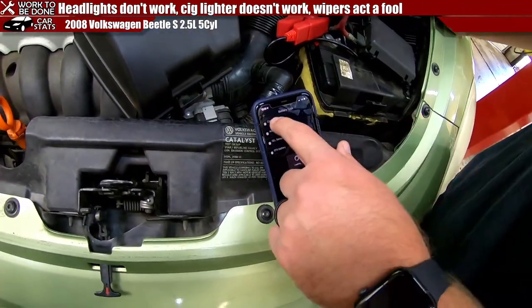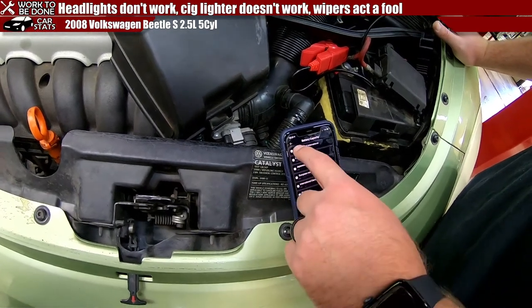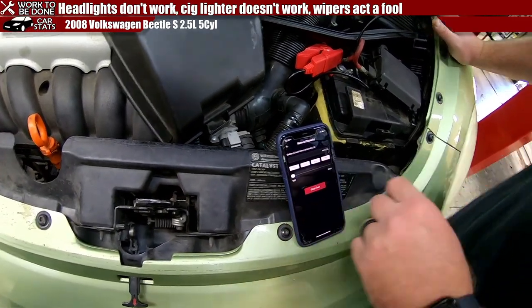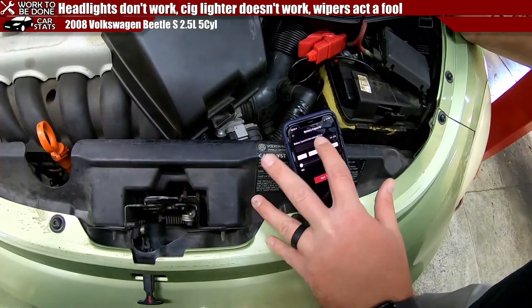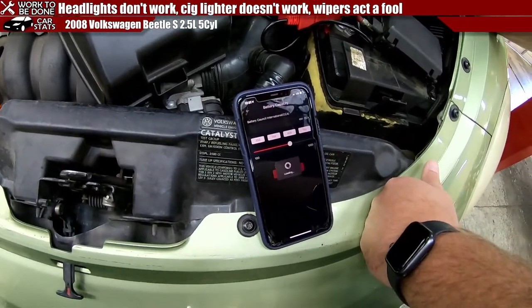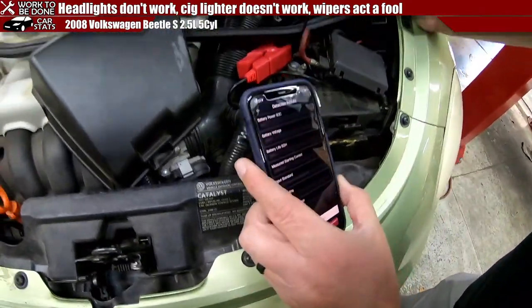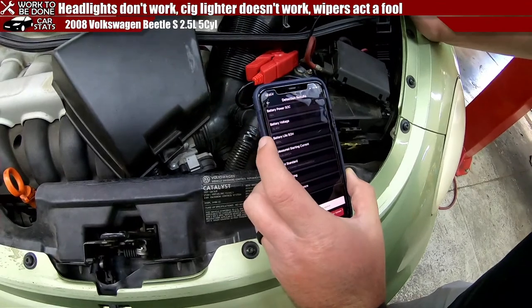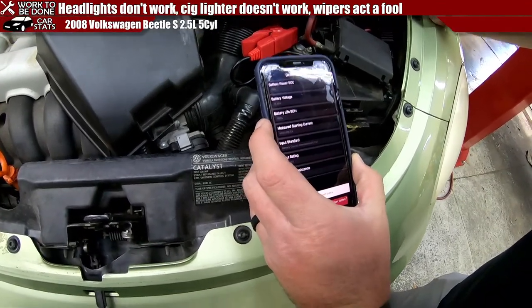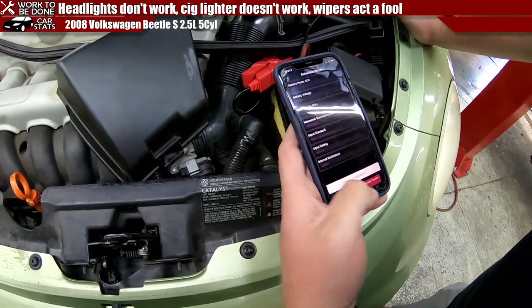So what kind of battery is it? It's a regular standard battery. It's probably an H6. What's the cold cranking amps on it? Probably about 650. So you click on 650, hit start. Hope that reads accurate because it's got a shitty connection. So 75%, battery voltage is 12.4, battery life is 100%. They could make the font not dark gray, but that's about it. Battery's in good status.